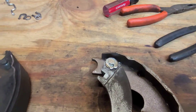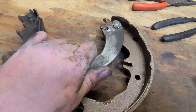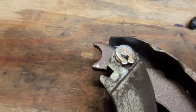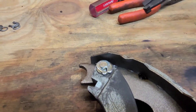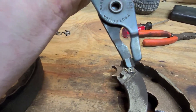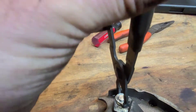When replacing the shoes — these are just the park brake shoes, nothing to do with the hydraulic brake system — you have to swap the arm from the old shoes onto the new shoes. It mounts onto this locating pin. There are two ways to get these clips off, but if you've dealt with them before you know they're a major pain. Fortunately I have a special tool here — it's offset just a little bit. I've used it a couple of times and it still works fine, though it's hard to demonstrate one-handed.